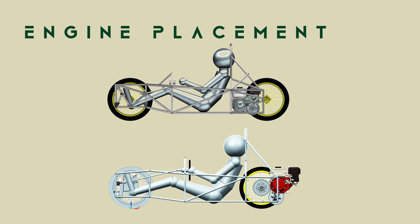We chose the mid-engine design as it packages everything a bit neater and it's more of a conventional layout, though it does introduce a few additional complexities in the detailed design. For weight distribution, having more rear bias should be better given drive and braking are on the rear axle only. But at this point, without tyre information, it's just a guess. The rear engine configuration can be optimised but we don't feel it's in keeping with the look of the Lotus 25.